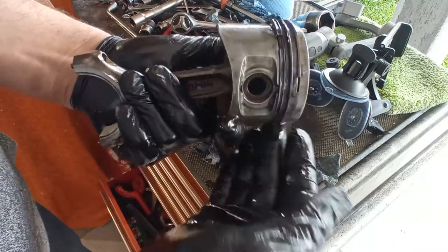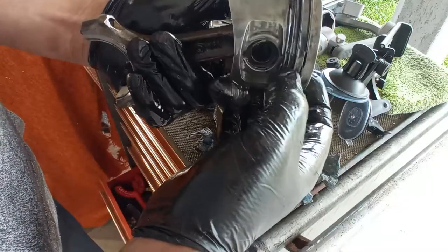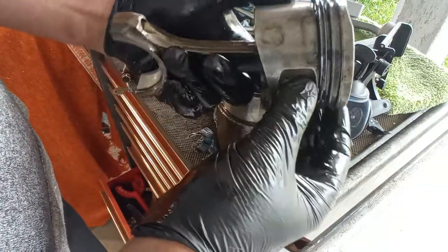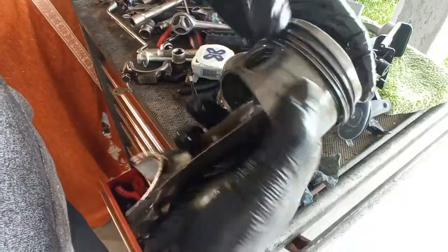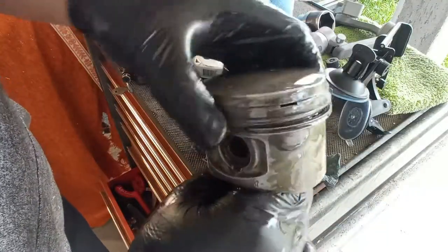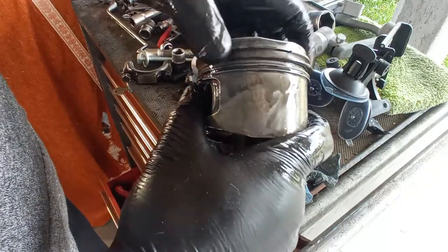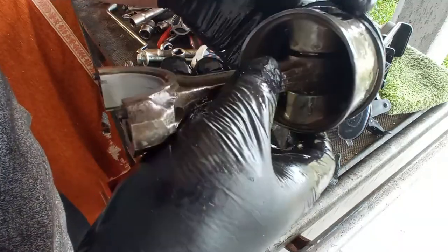And I have this very strange color of oil that I now understand may be the problem of contamination of the new oil with dirt. So you have dirt and oil in the oil galleries, and the new oil pushes out all of that stuff, and it is the first thing to lubricate the new assembly of the engine. So I think the problem of this engine was a lack of proper cleaning while the engine was being assembled.